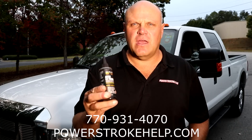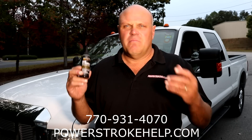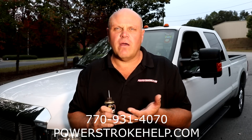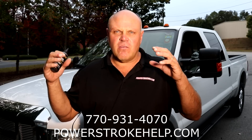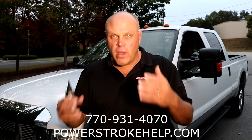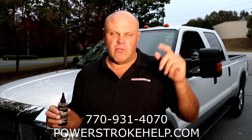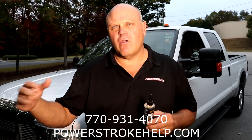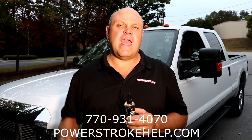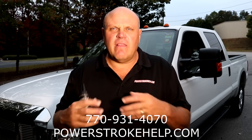I'm going to take you in here and show you an idea about how to do some service to these front hubs. There's no real service procedure for these hubs - they're supposedly not serviceable - but I've got one little trick to show you. These hubs go through water, salt, mud, they're being dealt with all the time. I'm going to use a lubricant here - it's an ArchOil product made for guns, especially good for guns that have become a little rusty or crusty. It's a penetrant. You don't need to use the ArchOil gun oil specifically - it's just what I have on hand. You can use any type of oil or light grease, anything that is not so thick that it gobs up but actually flows. Don't use WD-40 because it's a dry lubricant - you want something that will actually lubricate.